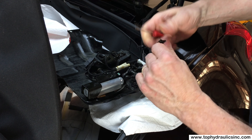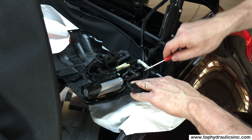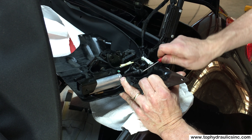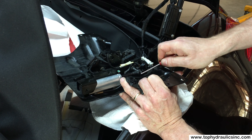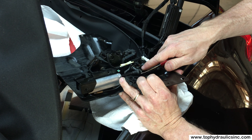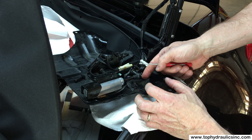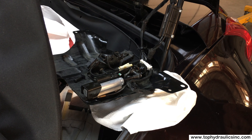Let's put these two pieces back together so we don't lose them. The ball joint in the front is easily dealt with as well. It has a black circlip here that you want to put your flat screwdriver under — that expands the circlip. As you walk it off its original position, the circlip releases.